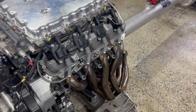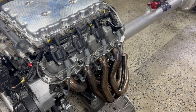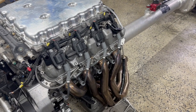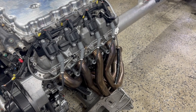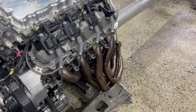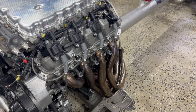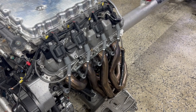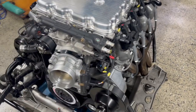The fairly cheap stainless headers I have are discolored and look a little bit ugly. They shouldn't corrode, but I don't much care for the way they look. So I'm going to do a little bit of work to the nearest tube to the chassis, to the subframe on this side. Just clearance a little bit. So I'm going to move that tube just a touch. And then I think I'm going to take these in and get them Cerakoted just to make them look a little bit nicer. Everything near it is temperature protected. I'm not super worried about that, but just keeping them looking a little bit nicer would be great.